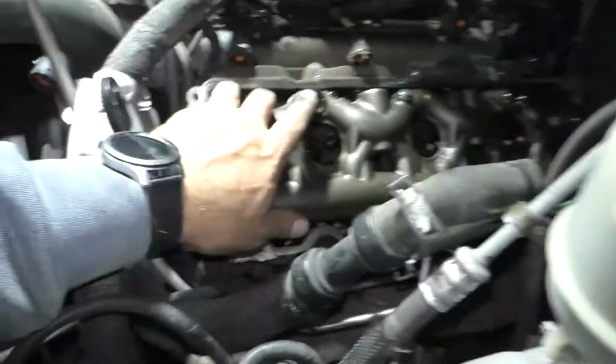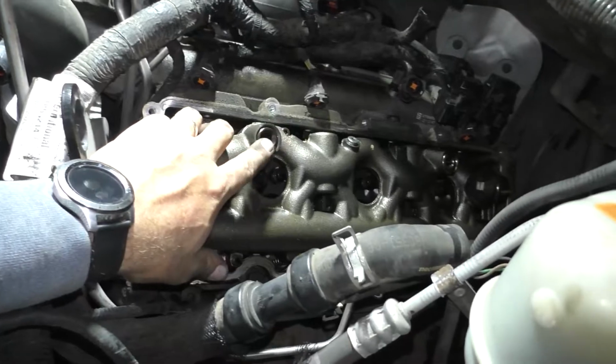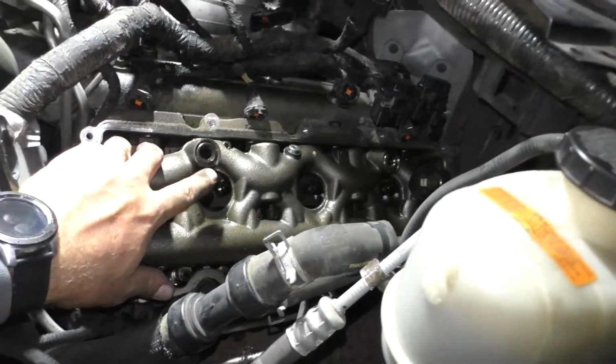All right, guys, so we just got the valve cover torn off the other side and got everything torn down. We checked for leaks again with air, and it's not near as dramatic. But we came across something very interesting that I wanted to show you guys. You remember how we said over here that this one had never been changed? Well, this is a 10 millimeter Allen head right here. Stock is 10 millimeter, the upgraded ones are 12. Guess what's in the other side?